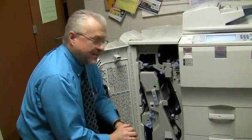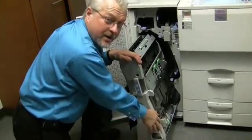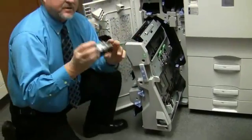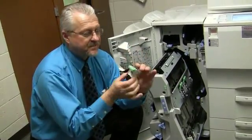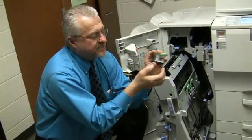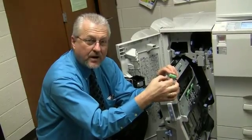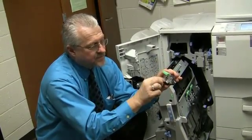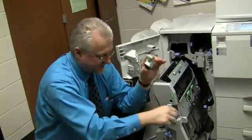Now if you have to change your staples on this machine, again what you do is pull out R10. Down here where it says S1, this is your staple cartridge. You simply flip it out like this — it comes out and it looks like this. But when you change it, you don't throw this whole piece away. You simply throw away the cardboard piece with the arrow. These are all your staples in here right now. When it's empty, it's going to allow you to push here and it's going to open about that far. You're going to take that cardboard core out and put the new one in with the arrow facing the front. You're going to click it down. Then there's a strap in the back you're going to rip off — but don't rip that strap off while it's in this cartridge, otherwise all your staples are going to be on the floor.